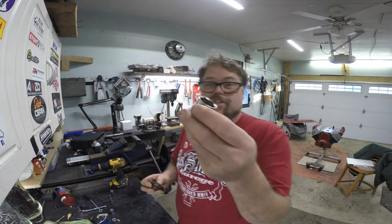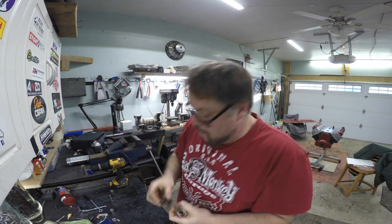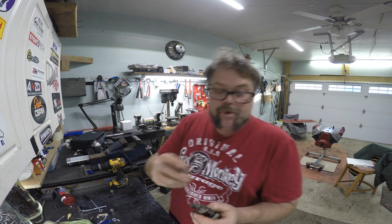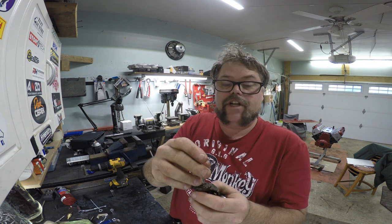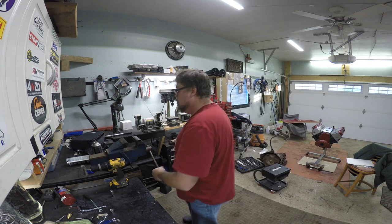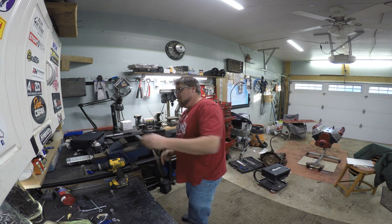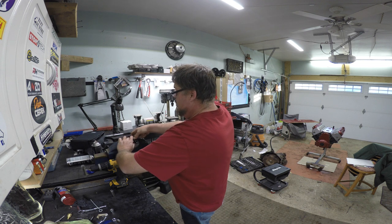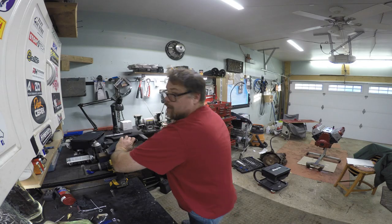So what I'd look for is a socket that's the same round as that, just sits on it. And then I'm going to push the center of this one through. Now you can push the whole thing through, but I'm just going to push the center through. It'll be a little bit more time consuming this way, but that's the way I like to do things. I'll put the vise open like so, and I'll make sure this lines up like so. And I'll open this up more like so. Because, can you see me?